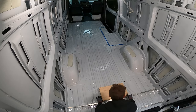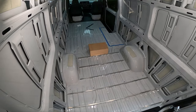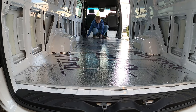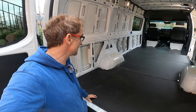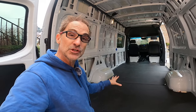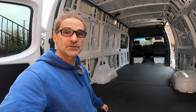Quick recap: we've installed the three-quarter-inch square aluminum tubing joists at an eighth-inch thickness, put down the three-quarter-inch polystyrene foam insulation, and cut the mass-loaded vinyl — an eighth of an inch thick — to fit the whole van. It looks pretty cool. Next, I'm going to use these vinyl pieces as a template to cut the plywood so it fits beautifully in the van. And I think now might be a good time for some banjo music.